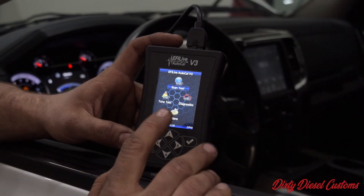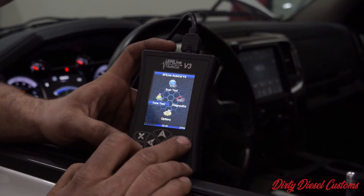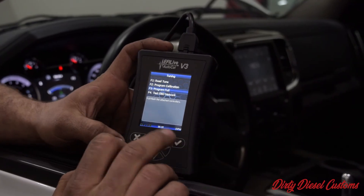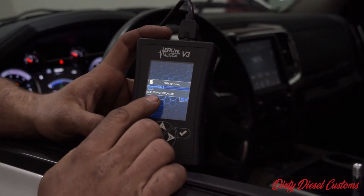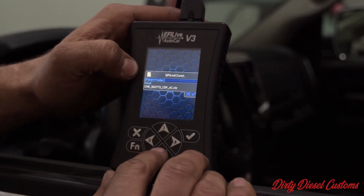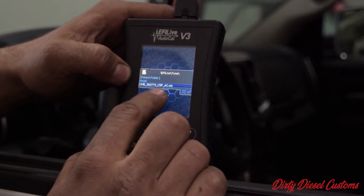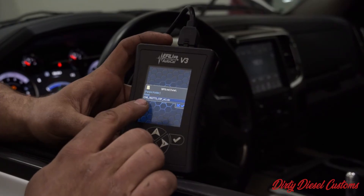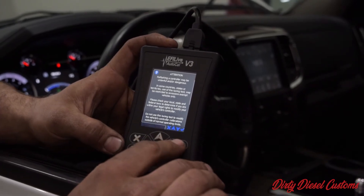The first thing you're going to want to do is turn your ignition to the run position. Once you get to the main screen of your device, slide over to the tuning tool and click the check mark. Select tuning and come down to program full. Once you're in program full, check that the six digits in the tune file match the last six digits in your bin to verify it's the right file for your vehicle. If you have an 08 to 12 Cummins that required a boot patch file, you would see that displayed here — load that first, then your custom tune file after. Once you highlight the selected tune, click the check mark. This will give you a couple warnings that you should read through and then proceed.